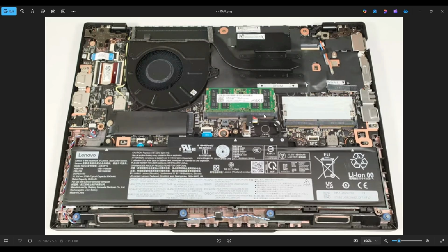To get the RAM stick back in, if you look at your RAM stick, you'll notice there's a long part and a short part to that port. So you can't put it in upside down, you can only get it in the right way. And once you get it in nice and straight and flush, make sure the gold part is nice and even across here. Then you just press down in the center and these arms will latch onto it and hold it in place.